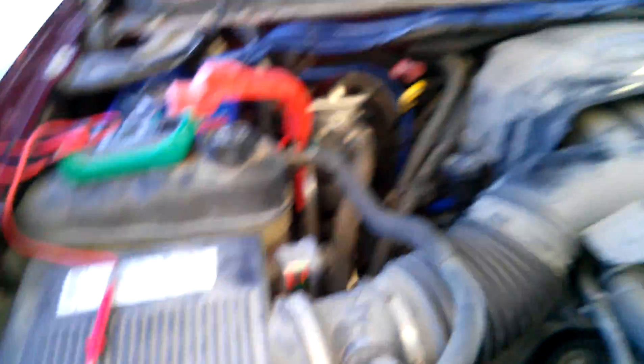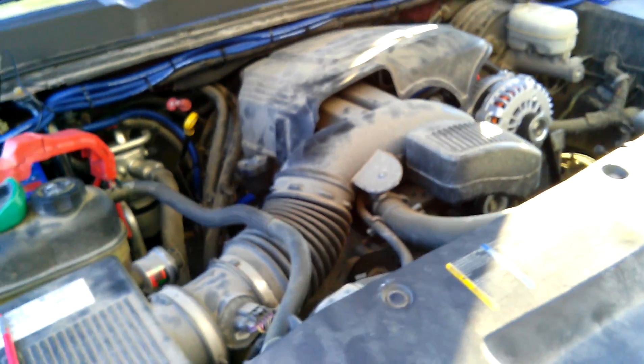There is no real way around this RVC system that Chevy, or GM, has put in. You can't externally regulate it. But 2007 and up, there is the grounding amperage clamp on the cable right there. I have metered it out. I am going to try to figure out a resistance to provide to it to get the voltage right where I want it, but there's an easier way to do it than that.